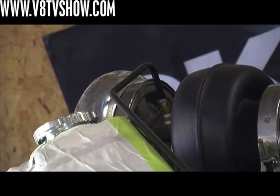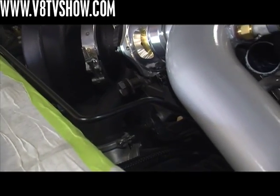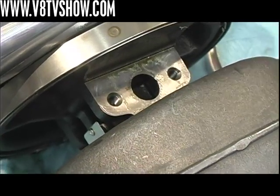There are a few more miscellaneous items that go along with a turbo system, and one is supplying oil to the turbo itself. These things require a constant source of oil to keep that bearing running smooth, especially because there's a lot of heat involved. In our case, we found an oil pressure takeoff on the front of the block and made a hard line that will supply the oil from the block into the top of the turbo. That oil is pressurized by the engine oil pump, but you've got to rely on gravity and residual pressure to get the oil out of the turbo back into the engine. The bottom of the turbo has a drain area where we welded an AN fitting onto a plate and bolted it to the turbo.